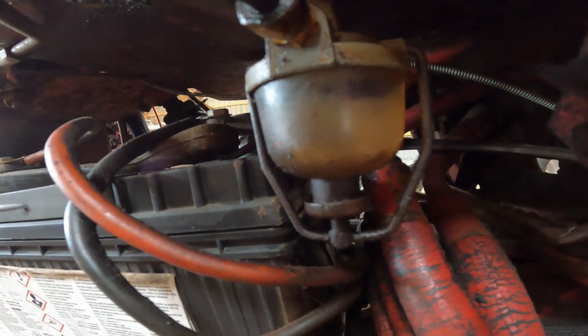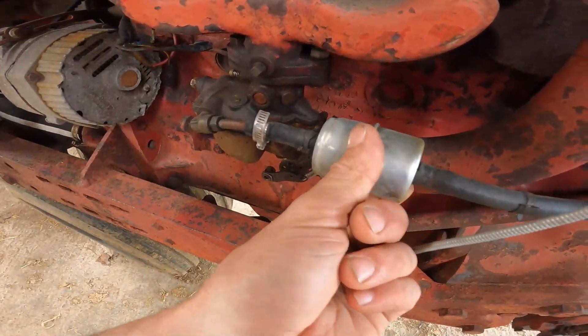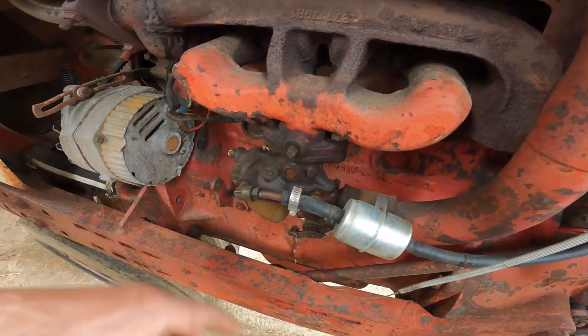In the midst of trying to start it, I can see the fuel flowing through — look at all the junk floating around. No wonder. I think this tank is a little rough so we may have to do something with that. Right there you can see it's starting to pour out. It's guaranteed there's junk in there. I'm not sure if this piece is supposed to be a filter or just a vacuum, but we need to put a filter in here that we can clean so it doesn't all get into the carburetor.